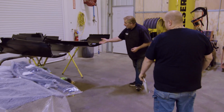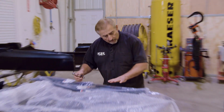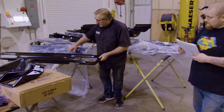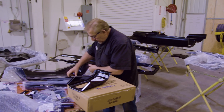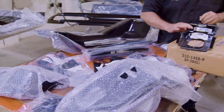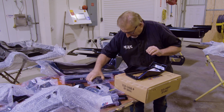We have a right-hand quarter full. Doesn't look bad, nobody's damaged it. Got a rear body cross member. You got your trunk floor extensions, you got your Dutchman panel. Nice rear body panel, look at that. I love that they punched the actual holes for the word Plymouth in there. That's really cool. You got your step wells, you got your bumper reinforcement, you got your upper deck package tray reinforcement, you got your vertical lock support for the trunk, emergency brake bracket guides.